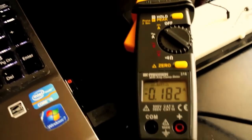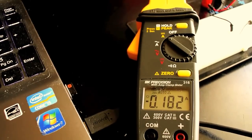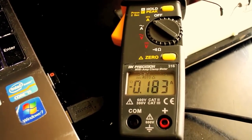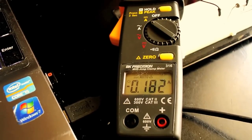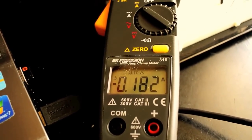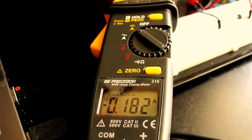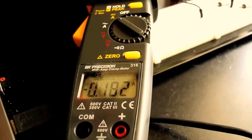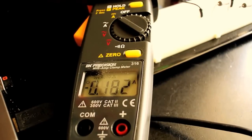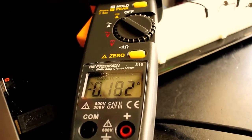So how significant is 180 milliamperes? Well, if you take 180 milliamps and resolve that into a 200 amp hour battery pair, that is two group 27 batteries connected in parallel, it's going to give you somewhere close to 200 amp hours. And even at this load, with an 180 milliampere load, in about 45 days the battery will be completely discharged. And so that's real world. You could fairly easily have a battery sitting in storage in your RV completely discharged in 45 days.